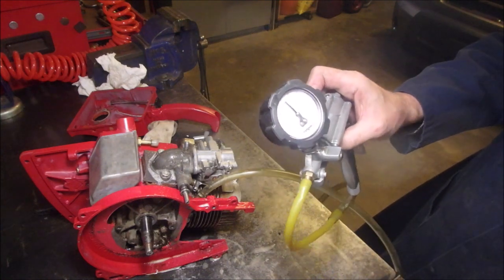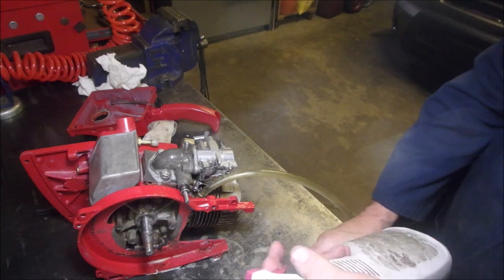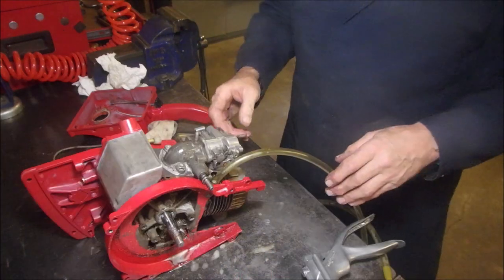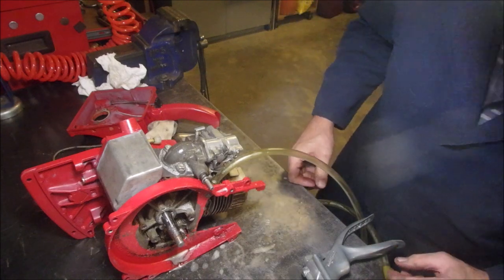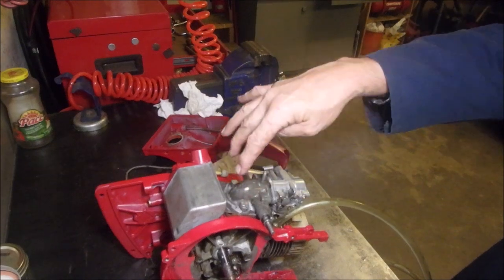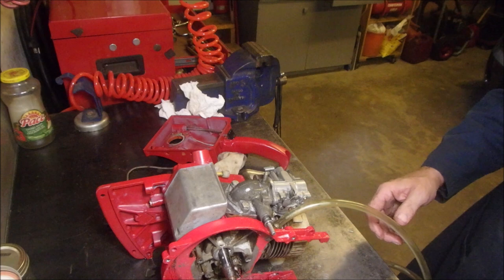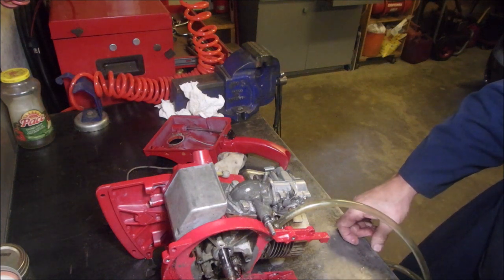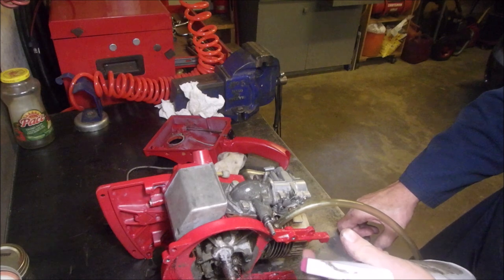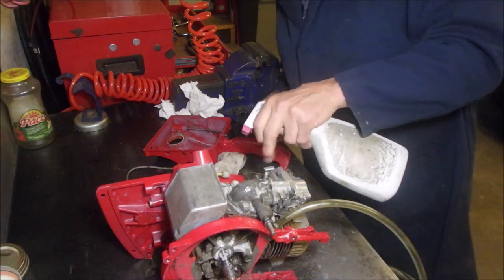It's holding at five pounds, guys. That's a big area. I'm impressed. It's holding at five pounds. What I did was I cut a new rubber pad and stuck it under the carburetor and just bolted the carburetor down. So there we are — isn't that cool? No leakies at all at five pounds. Five and a half pounds and it's holding there. I'm kind of stoked. I get excited over these small things.